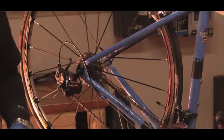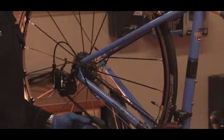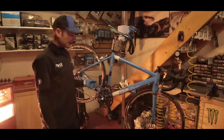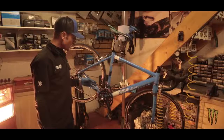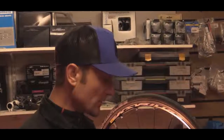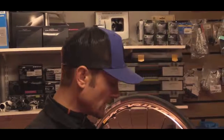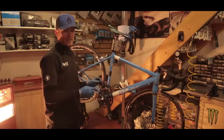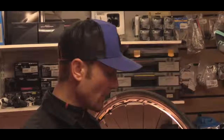So we'll go ahead and just punch out the chain pin on the Shimano system. It's worth being aware that the chain pins that Shimano use are all different — they look very similar, but you've got 9-speed, 10-speed, and 11-speed systems. The chain pins are the widths that correspond with the chains that go with those numbers of gears. So don't mix them up — use the chain pin that comes with the chain you just bought. They are all different.